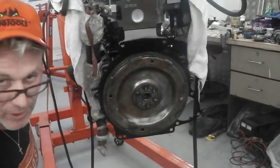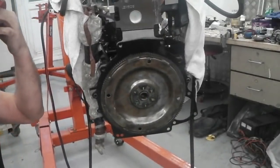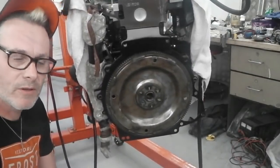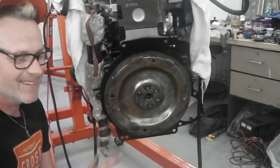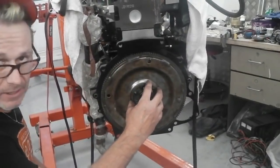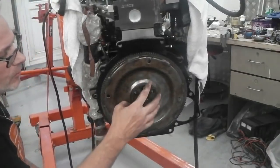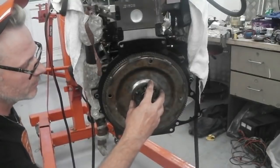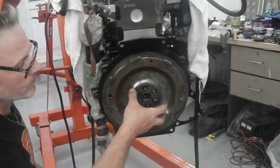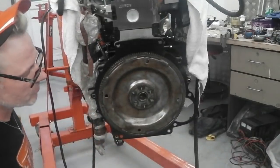And I've just re-watched the Ruby videos to see how I did it. I think I might have incorrectly mentioned that's a flex plate spacer. In some cases it is. On the Pinto here, it's actually a sandwich plate to basically reinforce the centre of the flex plate, stop it shattering. It's just a strengthening piece. It's like a very large washer.